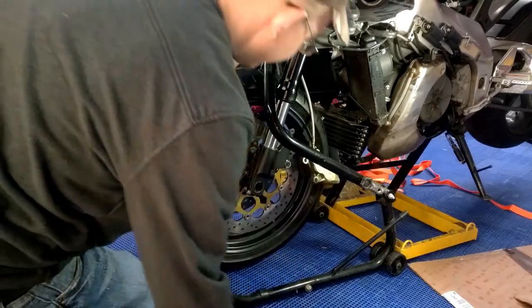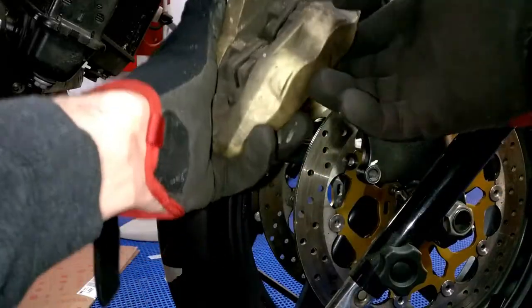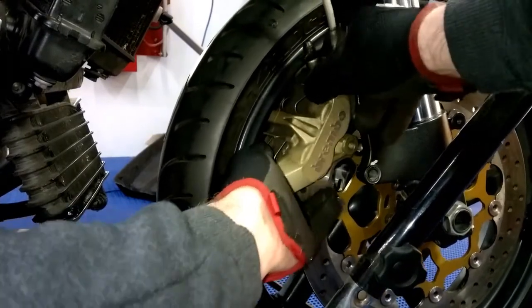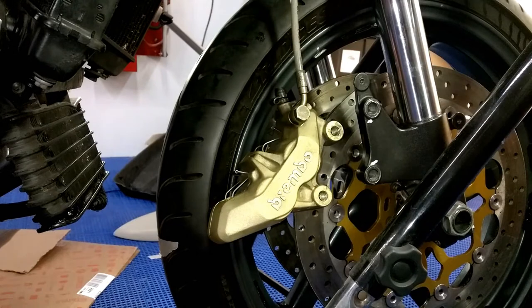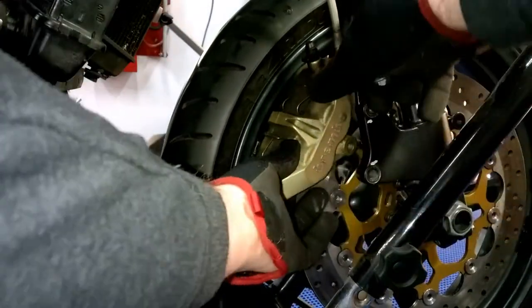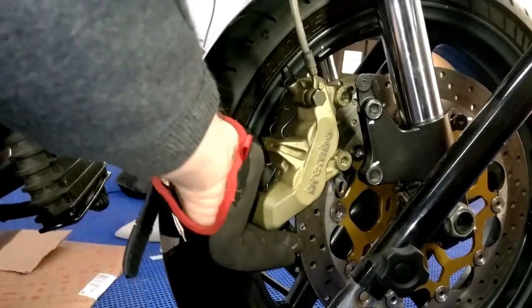We're going to go ahead and mount these brakes. I was going to put new pads on them, but we're not going to mount that yet. Just make sure all your discs are spread apart. Hopefully you were smart enough not to press the brake lever while you were doing all this. I might have to spread that out because these discs actually have a little more padding or surface than the old ones, so I'm going to have to spread these out. I've got those spread back out and you're just going to put your two bolts back on. Hopefully everything will go together like it should.